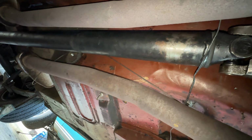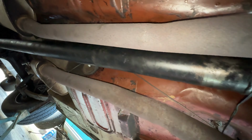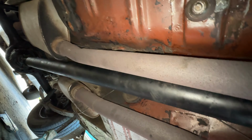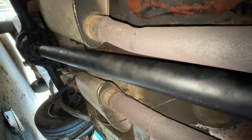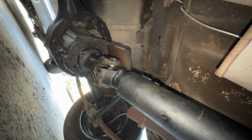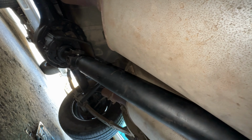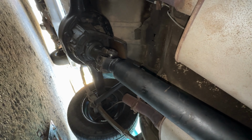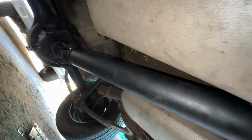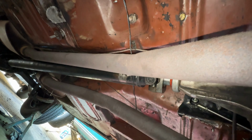All right, and there is the drive shaft installed, ready to go. And they actually did cut and rebalance the drive shaft. I believe it was about 1 3/8 inches. But just make sure that you measure your drive shaft and that you get your numbers right, because again, we think that this drive shaft was from a Ranchero. It wasn't the original one from the car. I think someone had swapped it out over the years, but now it is fitting really good. And yeah, we've got a very nice drive shaft down to the transmission, and this thing is almost ready to go.